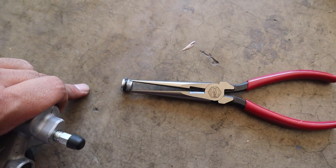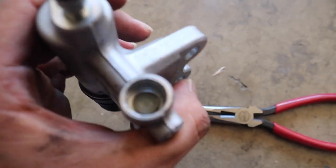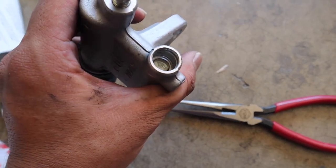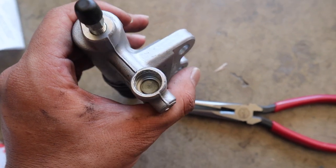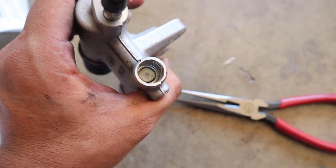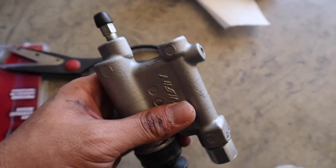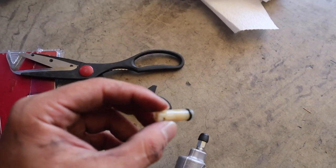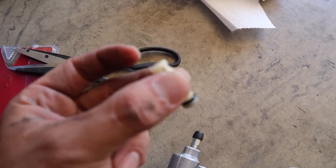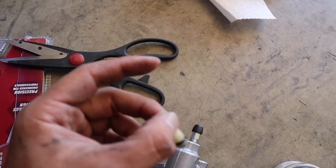This one was a lot easier than picking that little o-ring out. Now that you have it out, you can see right there the inside part — that's wet. You're going to get a picking tool, pick that rubber piece out, and pull it straight out. And that's what you're erasing. That's literally it right there — we got it out, and now it's ready to go back in essentially. So that's the clutch delay valve. This is where your fluid goes in and slowly comes out of these holes. Now that you've erased this, you can go ahead and throw it away.